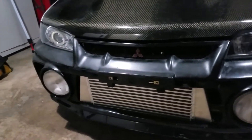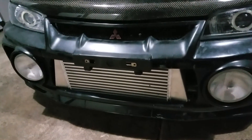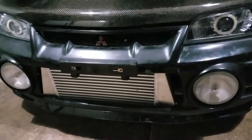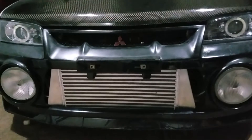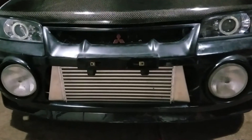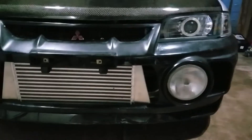They came with new corners, which is a good thing because mine were both broken. The front bumper couldn't make it into paint before getting the car tuned — we needed to clearance the intercooler. I got tuned last Friday and the intercooler showed up on Wednesday, so it was a mad rush getting this thing clearanced. This is a Driven Fabrication three-and-a-half inch Vibrant core intercooler. As you can see it fits perfectly — it's a little narrower than some aftermarket ones so it clears the fog lights pretty easily, which was one of my main concerns.